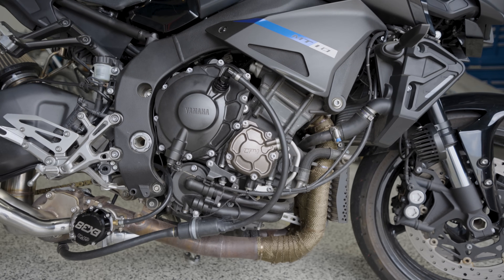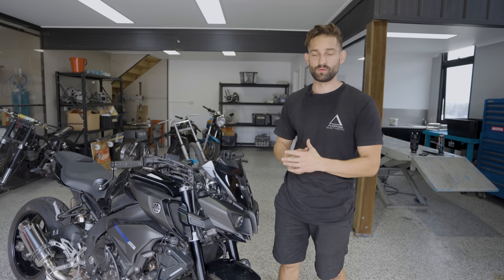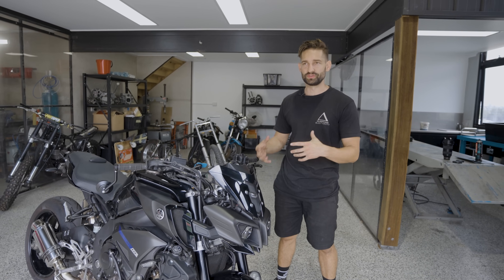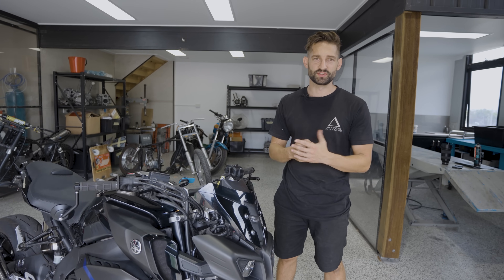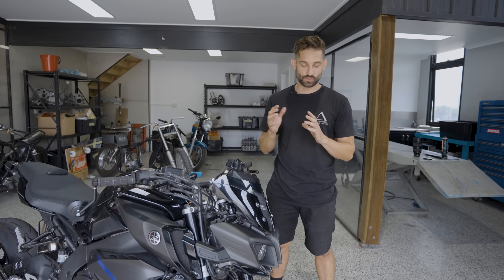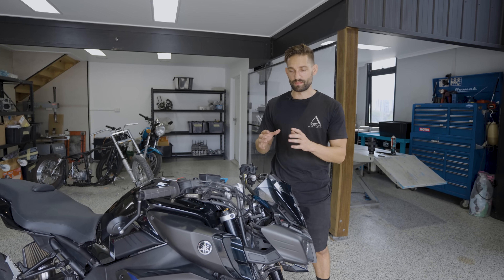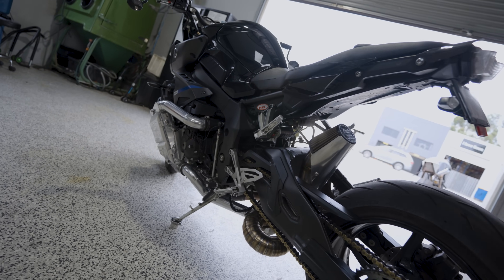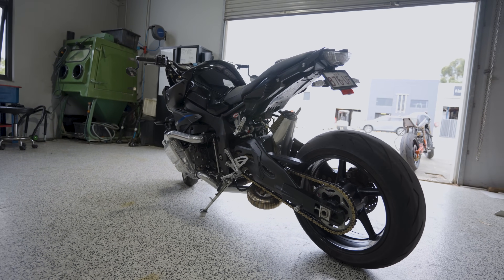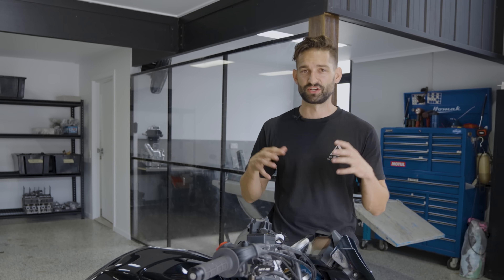Before sending this to the dyno, the engine was completely torn down and re-engineered. The intercooler, fans, intake, and all that was all leading into making sure what happened to this motor didn't happen again. Jesse pulled the engine down, figured out the weak points, and addressed them — he worked out the head geometry and compression ratios. We went back to CP Carrillo pistons, worked with them on a piston design that drops the compression ratio down to 9.5 to 1. We also upgraded the conrods — these motors are built very light, so the bottom-end rods were not going to handle boost on an already high-compression motor. We've got custom CP Carrillo rods and custom CP pistons so this bike will not only run fast but run reliably for Cassidy.